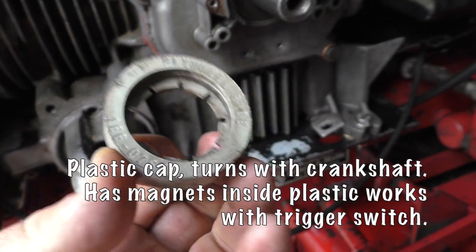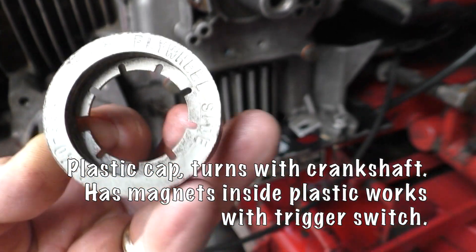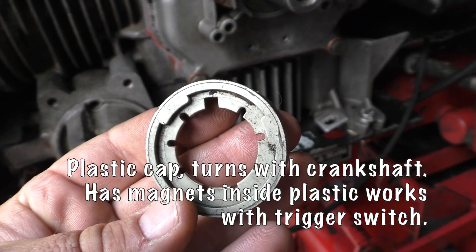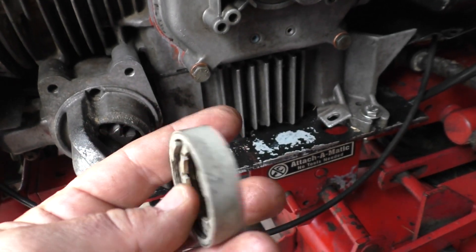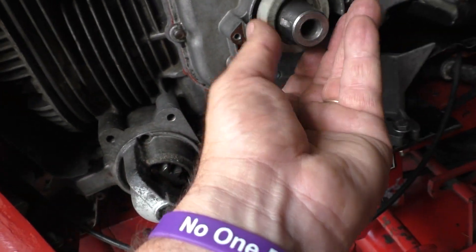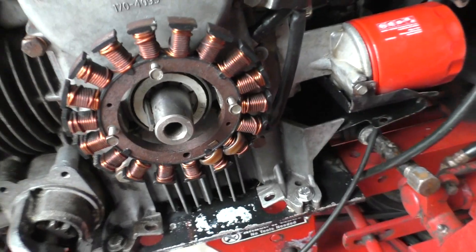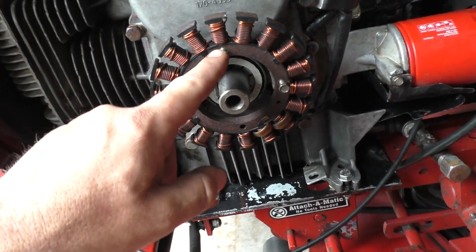In one of my old videos I made a mistake — this is the flywheel side, as it says right here. This is very important. I had it the wrong way when I first rebuilt this motor and couldn't get it to run. I went back through my steps, took this off, and realized I had it reversed. As soon as I put it on the correct way, it started right up.